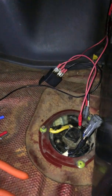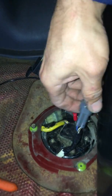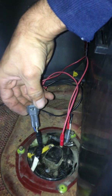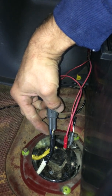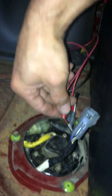I already have my battery located in the back so I won't have to run a power wire all the way from the front. There'll be two plugs — a yellow four-pin plug over here and a two-pin plug over here. The gray female connector going to the fuel pump: the blue-black wire is your hot wire. When that goes to the male connector it becomes a red and black wire, as shown down here.